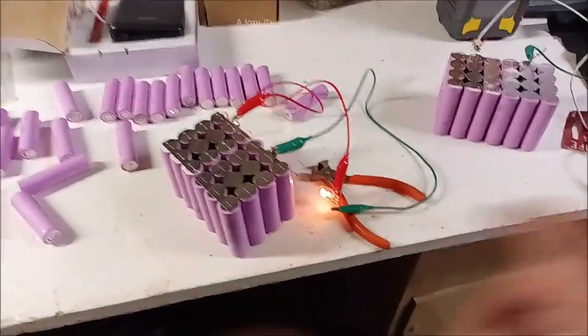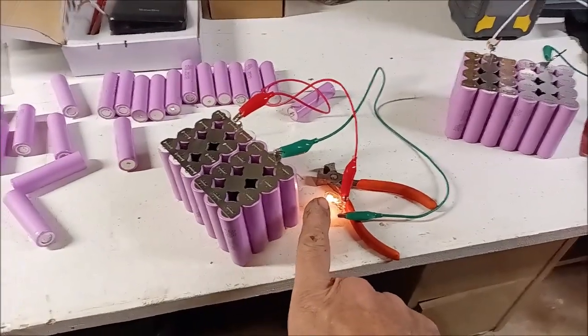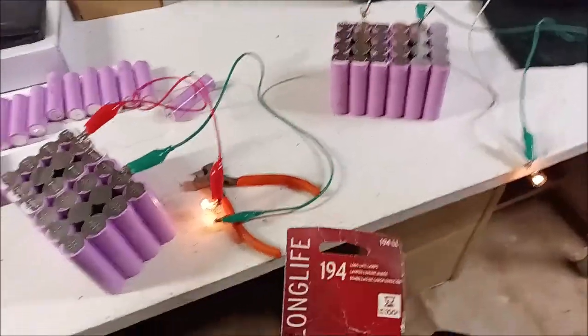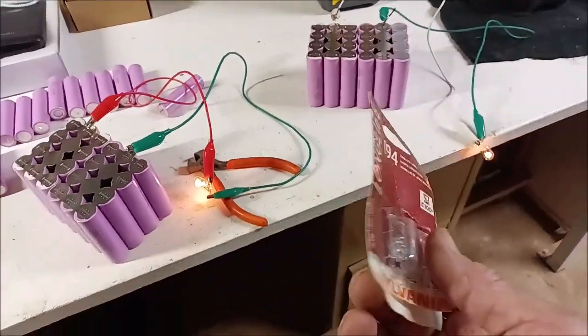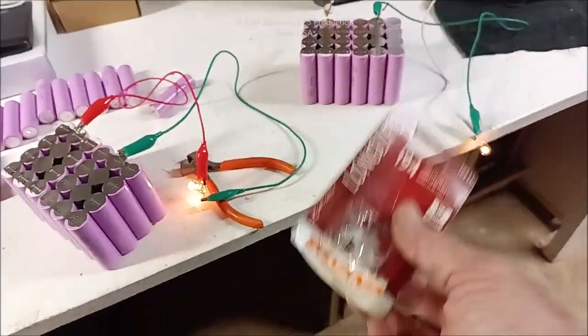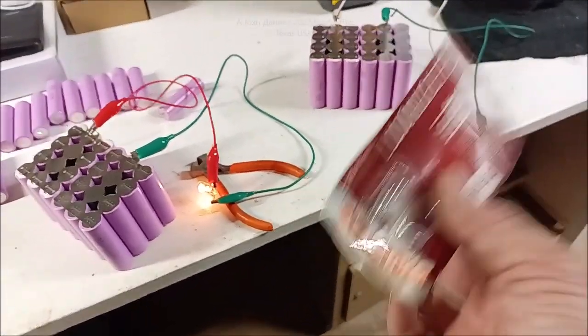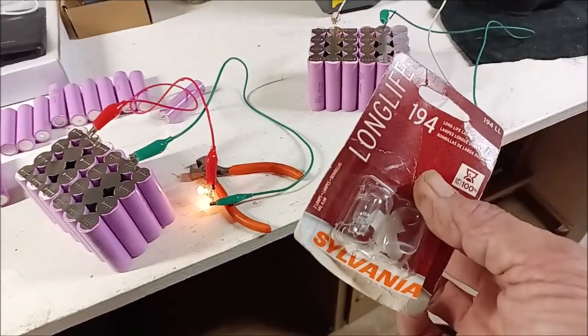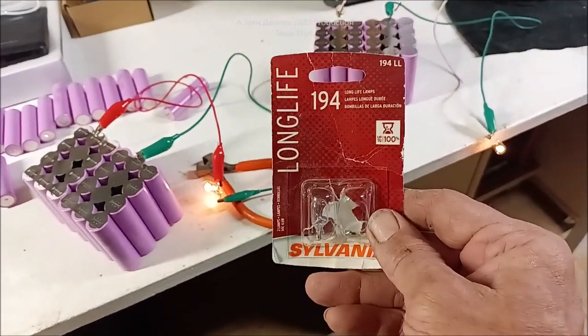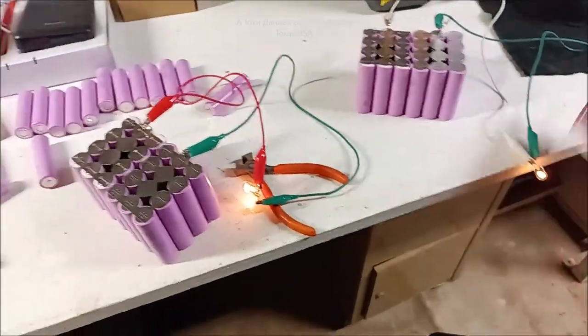Her goal is that these bulbs are good for four to sixteen volts — they're T10 style 194s. Now instead of going and getting 1156s that are only good for eight to twenty volts, this is a 7.2 volt battery pack, so she went and got the ones that are good down to about four volts.